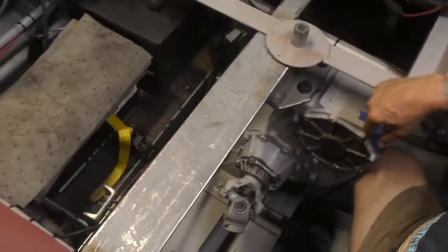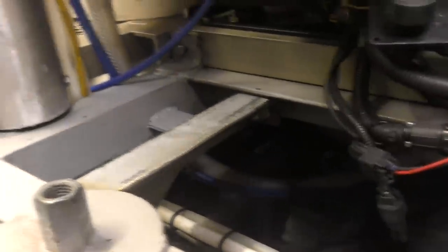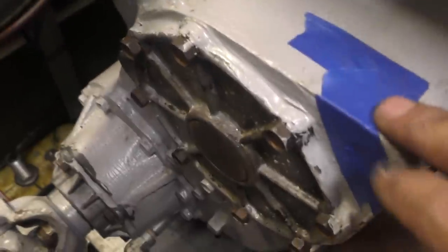Welcome to the Sailing Vessel Seeker. This week's job is to take the wiggle out of our transfer case. This beefy bracket, which connects to three of my crossmember frames, replaces this little wobbly thing — that's part of it. Up here it was doing this twisting thing, about an eighth inch of movement, which was way too much.